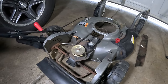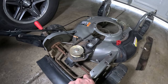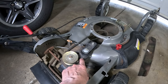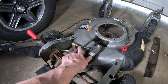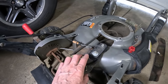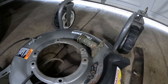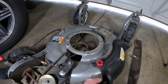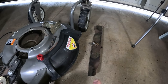So we have our Craftsman mower here. We've taken off the rear cover and cleaned up our little insect issue. We have the pulley here which looks like it's in good shape, the belt is in good shape, and here you have the belt tensioner with the cable that runs up to the Easy Walk handle. When you press the handle, it tightens the belt up and goes around that pulley. What I've done is taken the motor off — it's just going to be easier to do the oil change up on the bench. We're going to clean the carburetor. I did take off the blade as well.